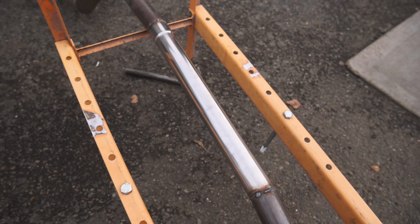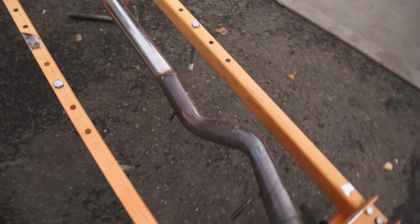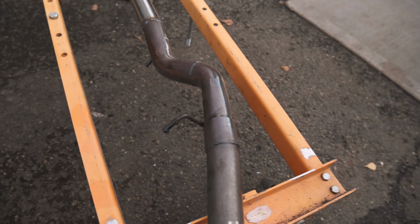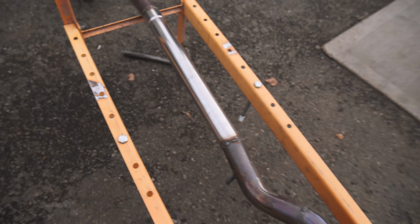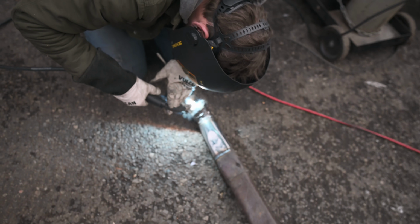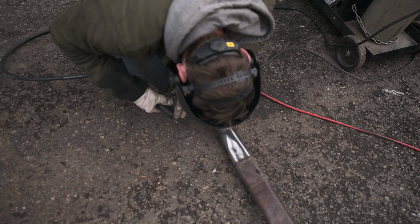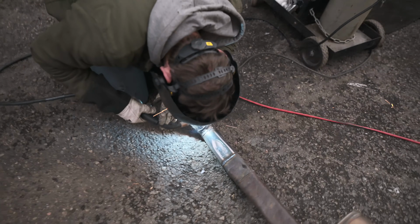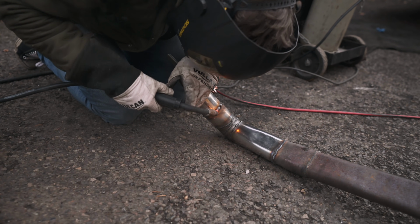instead of just one. Right here we took out one resonator because it dipped down to a 2-inch pipe, and we want 2.5-inch at minimum to flow throughout the whole exhaust. The whole exhaust is 2.5-inch. That way there's no back pressure buildup in the middle of the exhaust. Then in the front, Ruben re-welded a whole new flange to fit this manifold that we're running now, because when you go turbo you need a new manifold. So yeah.